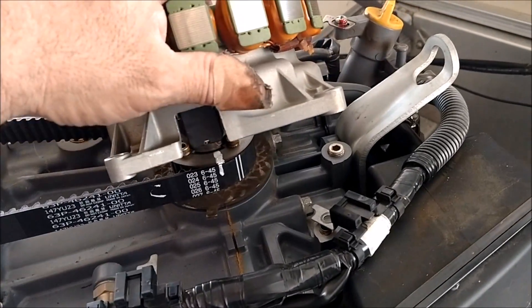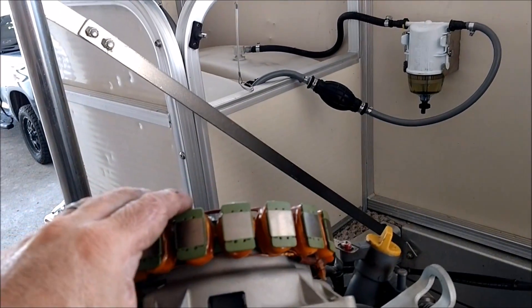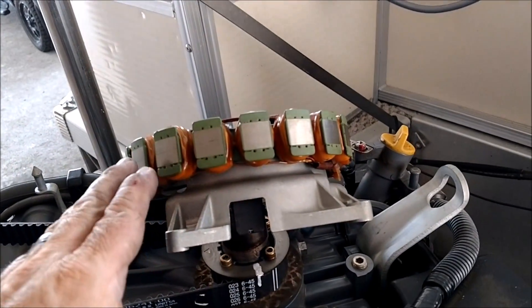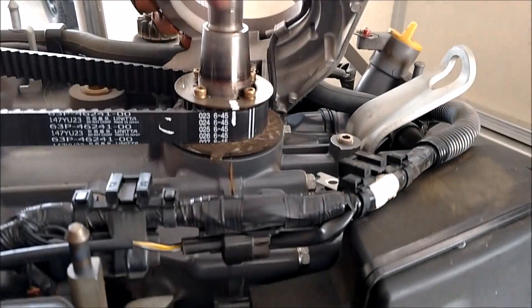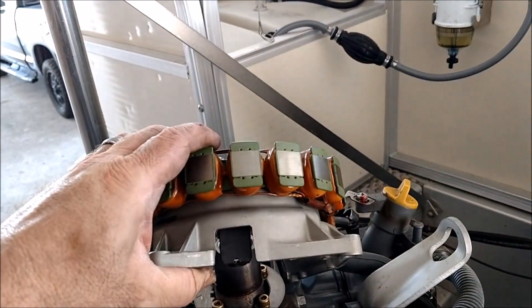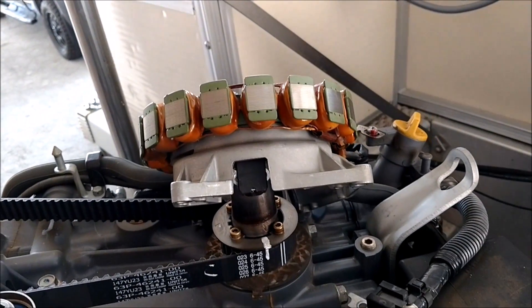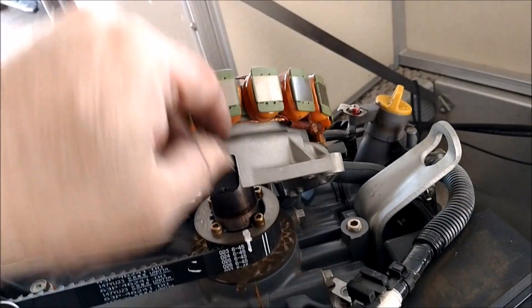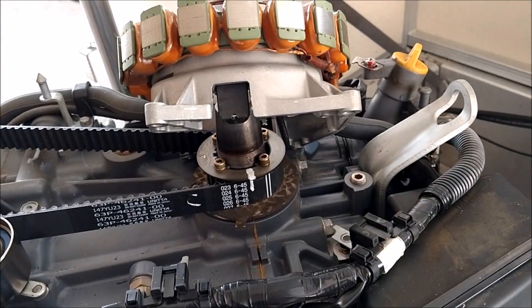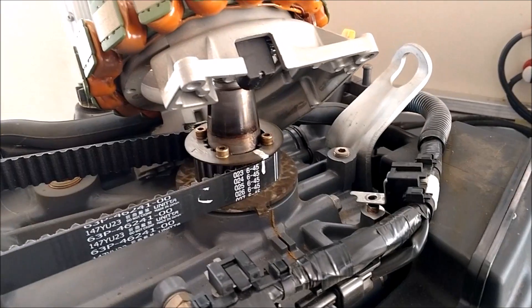When you do these, the stator has to come off. There are four 10-millimeter bolts that hold it. You can secure it off of a bar or something above if you need to — just be gentle with it. They say don't use an impact as you may damage the magnets when you're taking the big nut off the center of the crankshaft. So we did everything by hand. The flywheel was kind of tough to pull off even with an appropriate puller. We had to put a good amount of tension on it and then tap on the center of the tool with a hammer, and it let the flywheel jump up and get released. It's been on there about 11 years or so, maybe longer if the motor sat around.